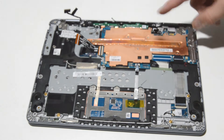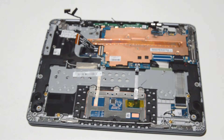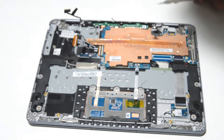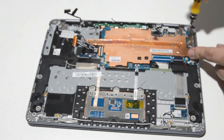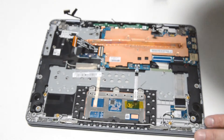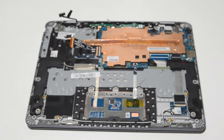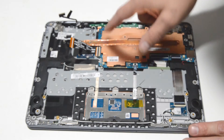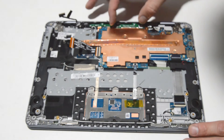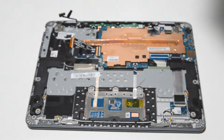For the video cable there's a little black tab — just pull back and it'll pull straight up off the motherboard. Now we can start removing the screws. We have all the motherboard screws out, including the ones going through the heat sink, so you have to remove the heat sink screws as well. There's just one more ribbon connector back here — just pop up with your fingernail.